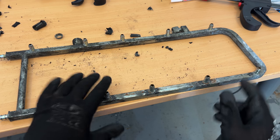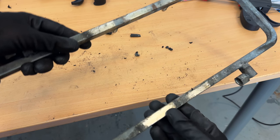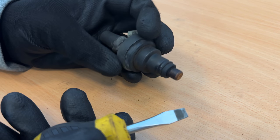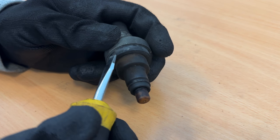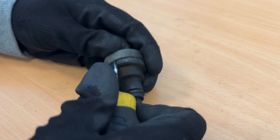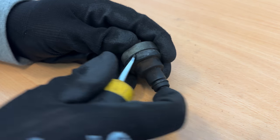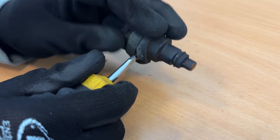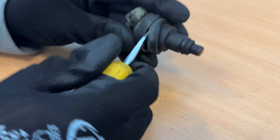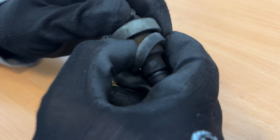And there we have it - one rail without all the extra bits on. As you can see it is a bit of a state - it's going to need a bit of a clean up. I think cleaning this up will just give that engine bay a little bit of gleam. First things first to refurbish these injectors is to get a little flat head underneath there and pull out this rubber piece. This rubber piece is something you do change as part of the service.